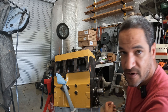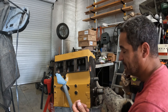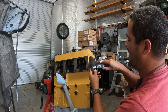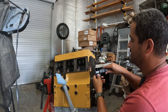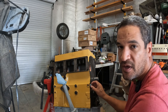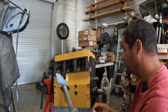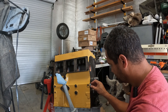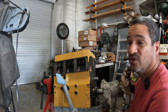This is all I could find at a different parts store — the guy there actually looked for it. It's close, but I need to mic it out. It's about half a millimeter too big — it's an inch and I need 0.98 inch. I was measuring the old one, so maybe there was some distortion from pulling it out. I'm hoping I can still press this in here — let's find out.